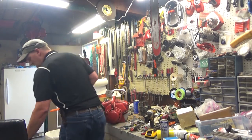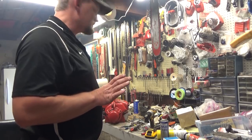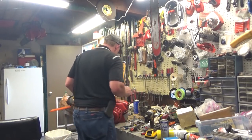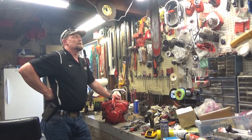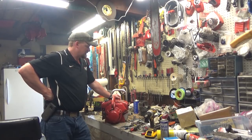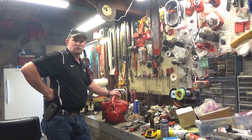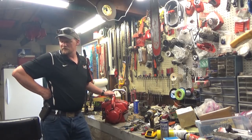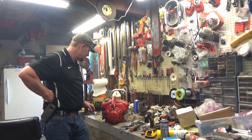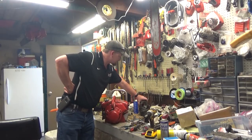It wasn't enough. So I found an old thread on, I believe it was Arbor's site, might have been OPE, I can't remember, but the guy on there had a great tip. He had taken the lamination out of that factory coil and then used a points coil from an XL101, 102, 103 Homelite, and that would fit in here on that ignition plate, so I did the same thing. I kept trying to use the factory condenser and I wasn't satisfied with that spark, so I put a condenser from that same XL101 series in here and matched up, and that got a beautiful blue spark. I mean, we're talking beautiful spark at low RPM. So I went ahead and did that at the same time that I was changing this out.